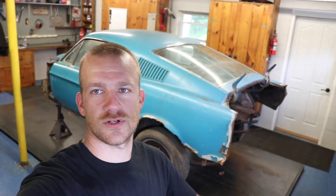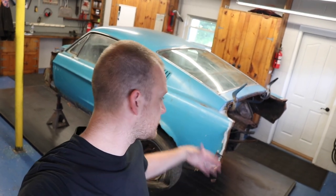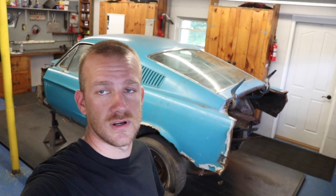So my next video is just going to be me starting on the disassembly of what's remaining left on the car. The glass, that door, the interior stuff that's still just hanging in there, get the rear out of it, just take it down to a bare steel shell, and then I'll start cutting apart from there. Like I said, I'll most likely do the cowl area, cowl side panels, get them fitted to outer rockers, possibly. I might just drop the floor pan in before that and then line outer rockers up to that. But, I'm going to get started on it this week. So stay tuned for those videos.